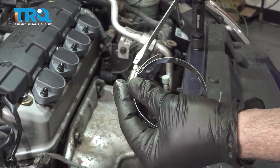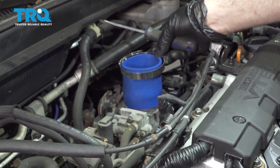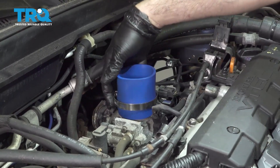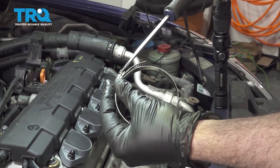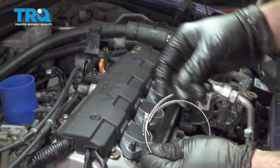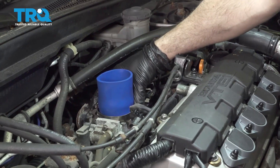I want to take our hose clamp and we're going to tighten this up a bit. The reason why I'm going to do that is when we line this up we want to have it close to fitting snug down here, so when we go to tighten it up we don't have a lot to do. So that slips right on over — we're going to take it up a few more turns. When we install it we're going to have the screw head facing the driver side. That fits down pretty good right there.